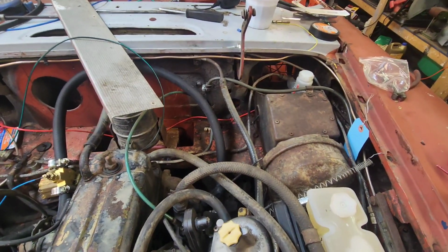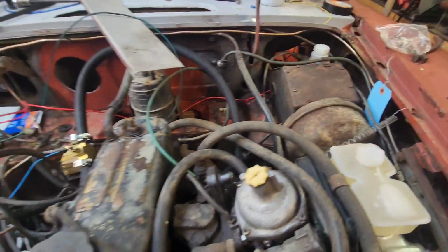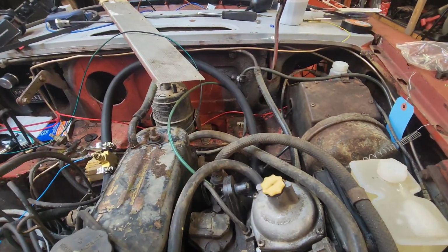All right, so we've got the wire ran from the fuse box over very loosely. I mean, it's just laying there. And that red wire is going to be the brake light wire itself. Now, I know I've said I'm trying to use less of the same color, and I've used a lot of red so far. But as I was going through colors, knowing other things I have to do, red made the most sense for brake lights, because brake lights are red, stop signs are red. It's red. And I don't have a black and green striped wire to match it to run to the back of the car that matches the one coming out of the fuse box. So I'm just kind of making things up as I go, I guess. I mean, obviously I am, because it's a custom-made wiring harness, but yeah.